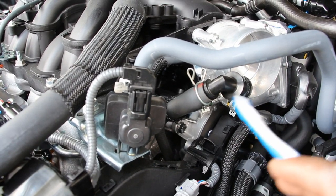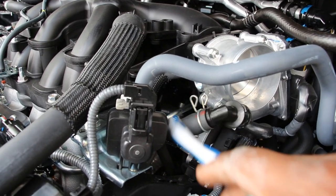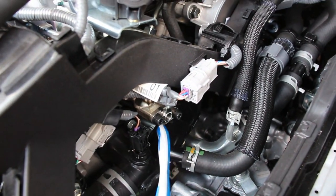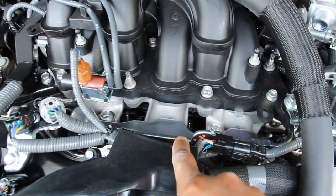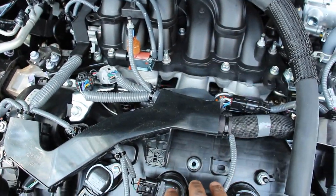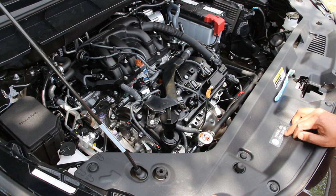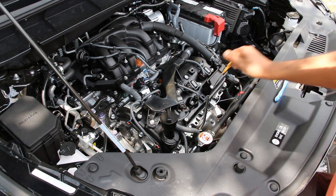The low pressure pump in the tank is going to bring gasoline up to the front of the engine, where we do have a high pressure fuel pump located just behind this vacuum pump on the rear valve cover — that's going to pressurize the fuel and bring it down to this fuel rail here which is going to directly inject it into the cylinders. In addition we've got another low pressure line here that feeds your regular port injectors located right here on the air intake plenum before it goes down into the valves — that's what's responsible for keeping those valves clean by washing off any carbon deposits. This engine uses a common 5W-20 weight oil with your oil filler located right here and the dipstick right up at the front.